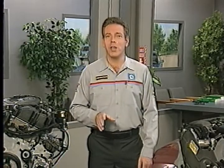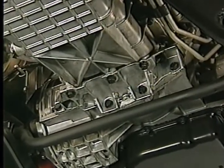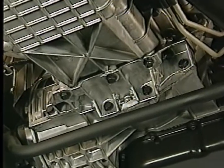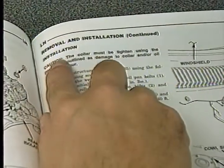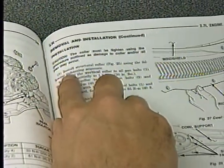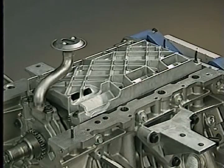Now let's turn our attention to some similar lower-end features of the 2.7, 3.2, and 3.5 liter engines. To minimize flexing, all of the engines have a structural collar that is bolted to the oil pan and transmission. To avoid damaging this collar or the oil pan during collar installation, it's important to use the tightening sequence detailed in the service manual. A structural oil pan and windage tray also increase stiffness on all three engines.